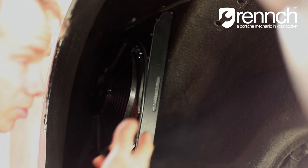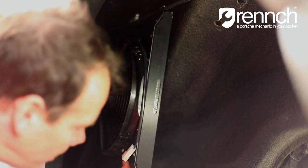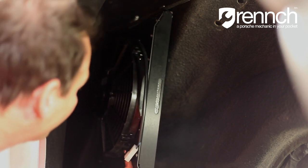It's going to be hard to show you guys how to make this bracket because it's so tight with the camera in here, but I'll do my best. So as it turns out, I'm going to need a nutsert tool to install the condenser down there. And the reason why is because I can only get to one side of it. I can't get to both sides, so I can't put a bolt through. And plus, it's just going to be a cleaner install anyway.